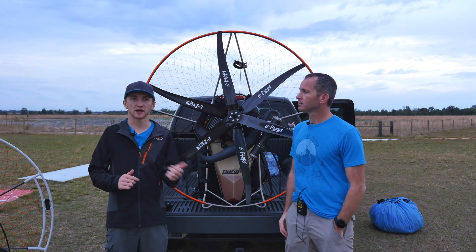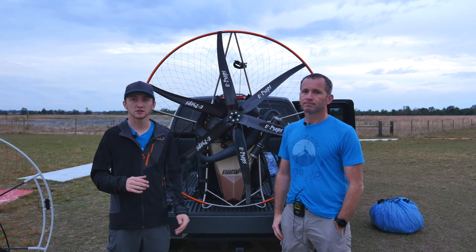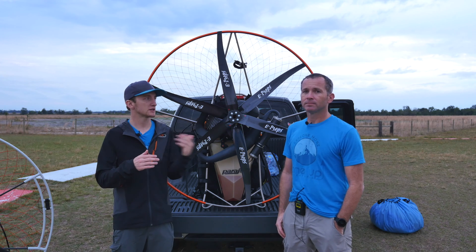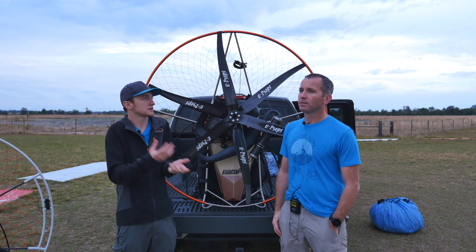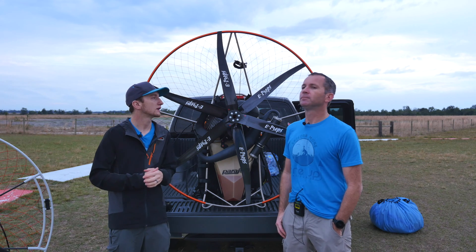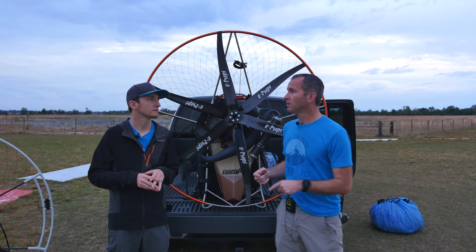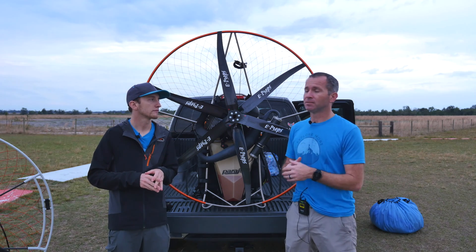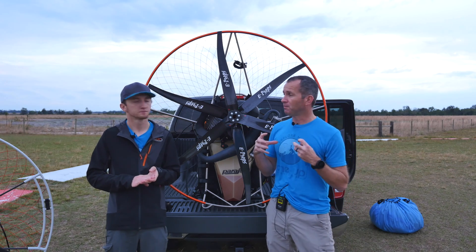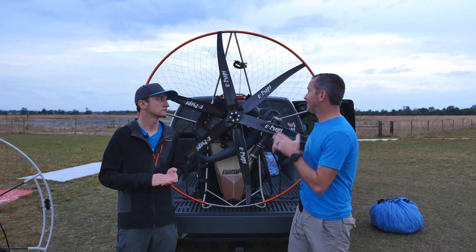This prop is not going to be for the slalom guy or the guy who's always climbing to high altitude. But if you're going to do cross-country, that's your main thing, you're flying for two hours at a time and you want better fuel burn — this will help with that. A two blade is loud; a three blade has more of a hornet sound, higher pitch. With the 2.87 reduction ratio we switched this motor to, the prop is actually turning slower than with the 2.68, which is probably a big reason for the quietness. The smoothness is because it has six blades.